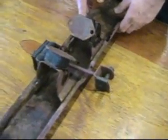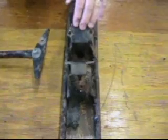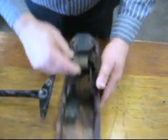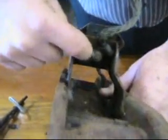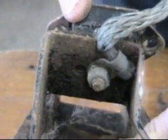So that's the setup — pretty easy. Now at some point in the future, I'm not sure if it's 1968 onwards or a little bit later, we end up moving from a single position for the gearbox mount to having a choice. You can see there's an extra hole here, so we know that these mounts can either sit fore or aft on the gearbox crossmember. Now this starts to get complex.